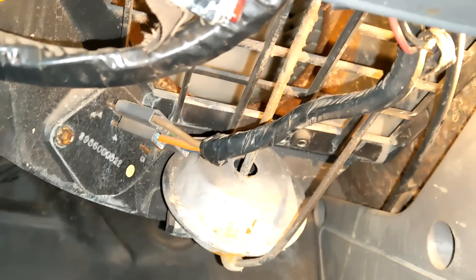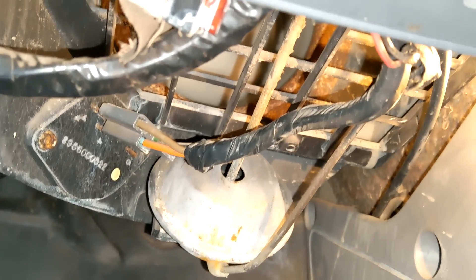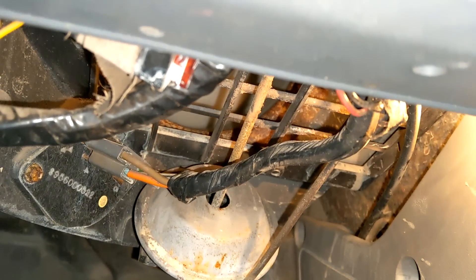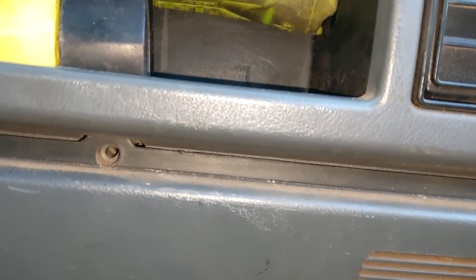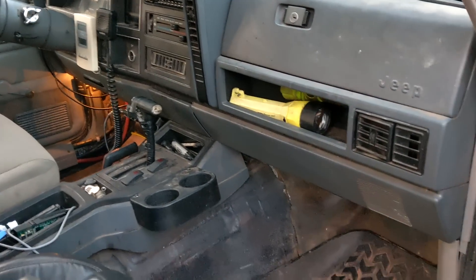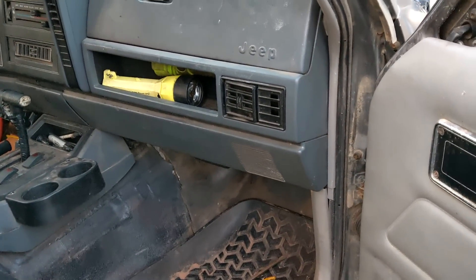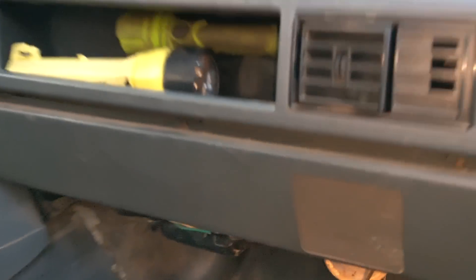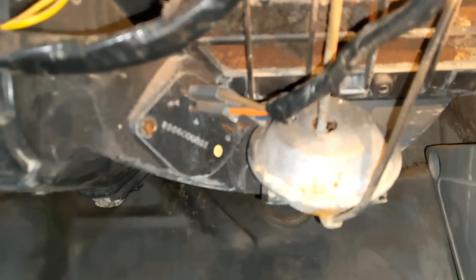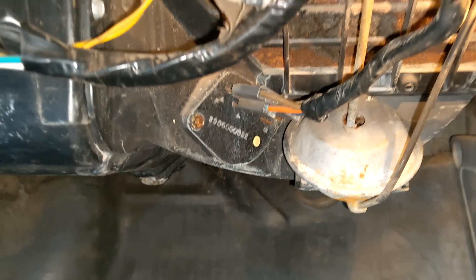We turn it off and turn it back on again - hey, look at that, the fan actually spins! All this time I've been without heat because something was just being stupid. So there you go. Sorry this wasn't a replacement video - this is more just a diagnostic to show you everything in the system. I do have a blower motor replacement video if you'd like to see that. You just saw basically everything needed for the resistor - all you gotta do is unplug it and put the new one in.